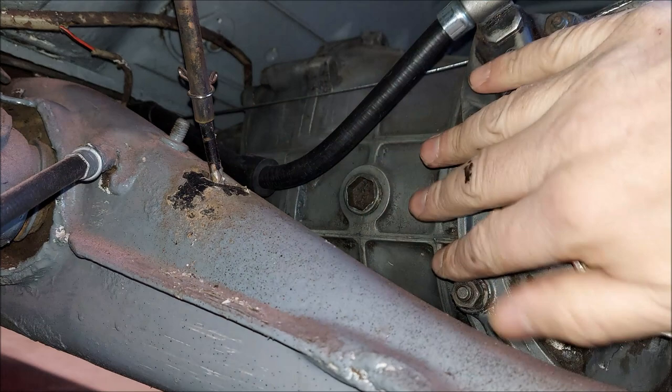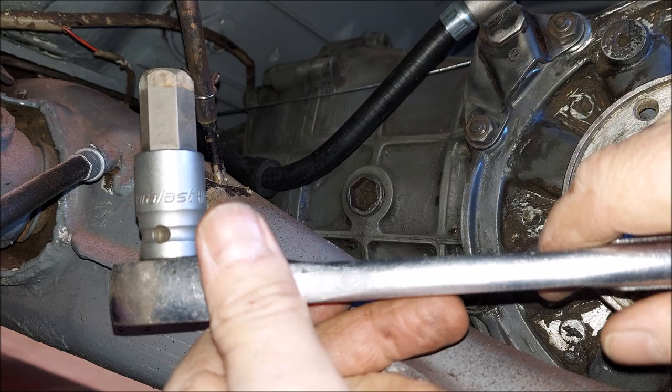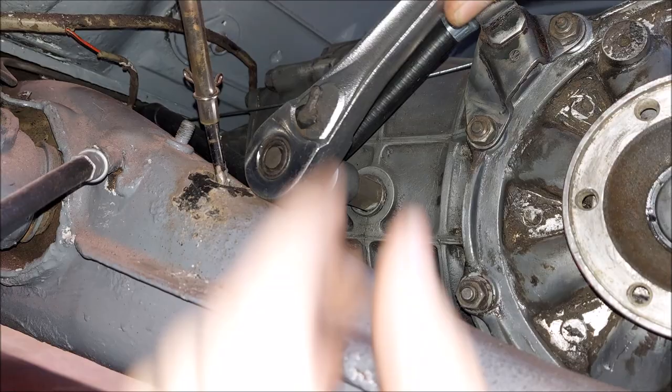I'm in the car and this is on the driver's side. That's a 17 millimeter Allen head, so buy yourself one of these. I got a three-pack at AutoZone of 12, 14, and 17, and you can get them online. You always loosen your fill plug first, because if you loosen the drain plug underneath and you can't get the fill plug out, you've just emptied your transmission transaxle and you're screwed. So let's loosen this first.